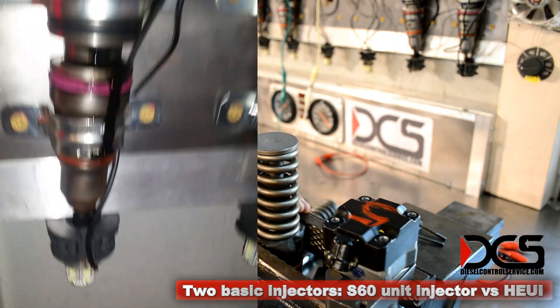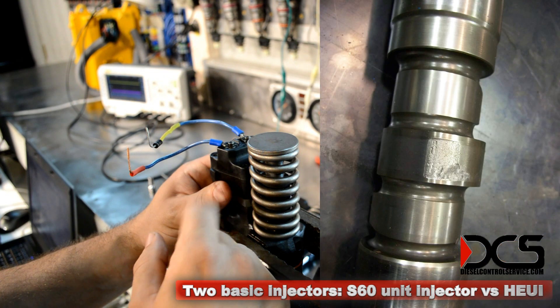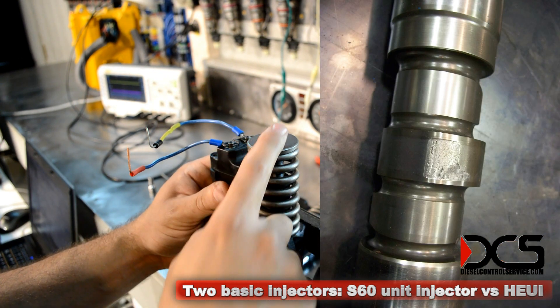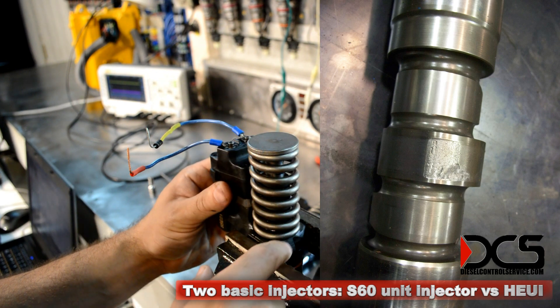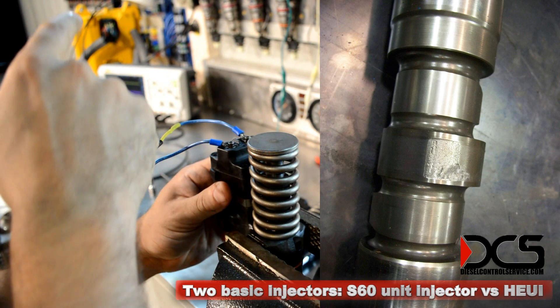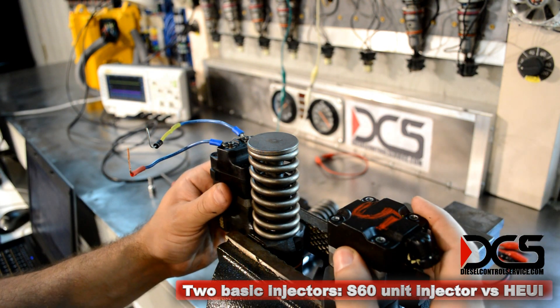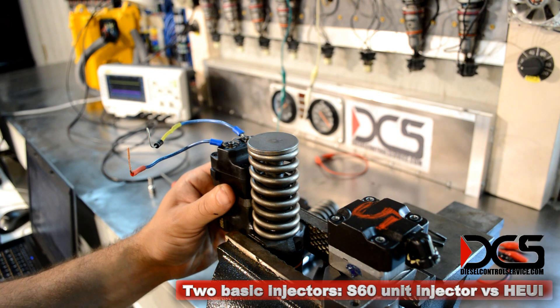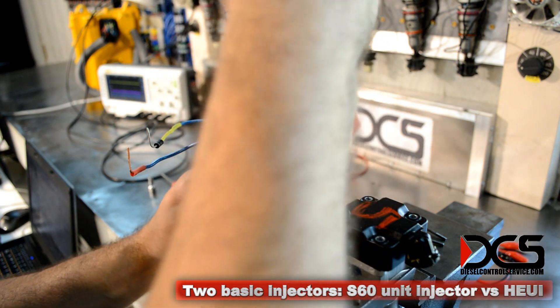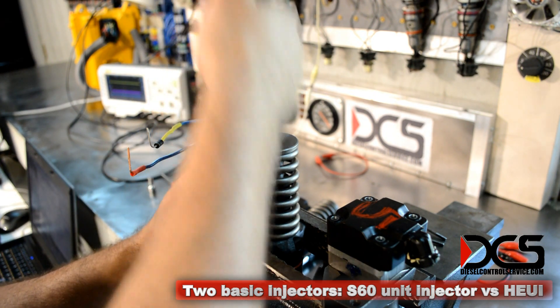What we have here are two very different kinds of diesel injector. On this one, the camshaft presses down on this plunger — there's a slope on the camshaft injection lobe, so the rate that this travels downward is very crucial to how the ECM is calibrated. Over here, this is a HEUI injector, so not as crucial. There's 2,000 pounds of oil pressure from a high pressure oil pump, and that acts as the plunger. So the plunger here is oil pressure; here it's purely mechanical, off a lobe off the camshaft.